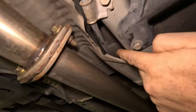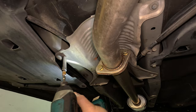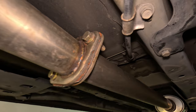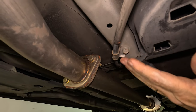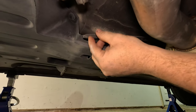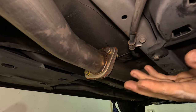The parking brake cable on the passenger side is right there, and the same goes for the driver side. Now that the heat shield is out of the way, we can start disconnecting the parking brake cable from the body. You're going to have some 12mm bolts connecting the parking brake cable via some brackets. On the driver side, you'll probably have to drop this plastic trim cover to access the cable bracket bolts. After which, we can finally be done removing the old parking brake cables and move on to the next step.